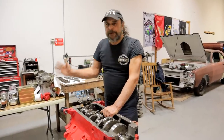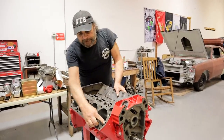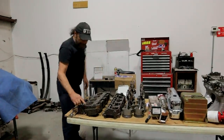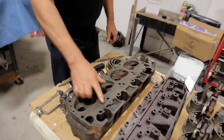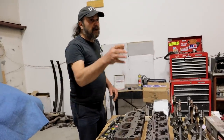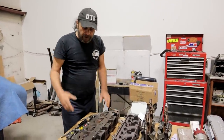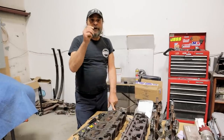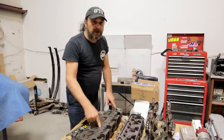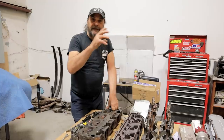You have to pay attention to every little detail. The blueprinting process applies to the entire engine assembly. For example, from the factory they put dowel pins in the deck to locate the cylinder head, with matching holes in the heads. When you put it together, the dowels are supposed to center the combustion chambers over the bores — but it doesn't always work out that way. So we'll bolt the cylinder head on each side and check that the dowels register the combustion chambers directly over the cylinders. We may find that one head works best on one side and the other head on the other side, or we may need to use an offset dowel.